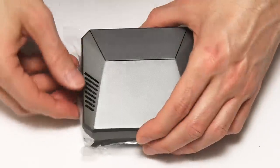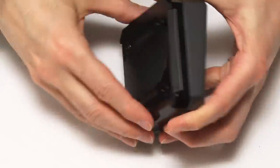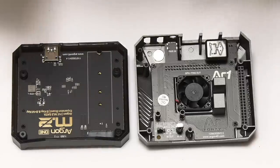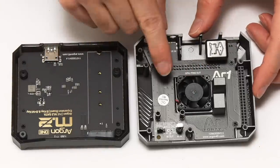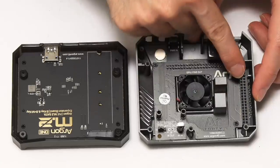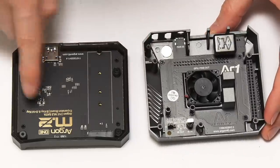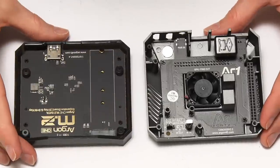Taking the case apart, you'll see there's a circuit board in each half. The Pi plugs into the circuit board in the top half of the case via its GPIO connector, so power goes to the Pi via GPIO. There is a power connector on the back of this board, which we use rather than the one directly on the Pi. And then the M.2 SSD plugs into the board in the base of the case.